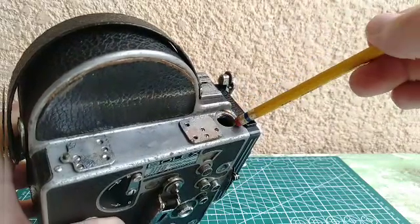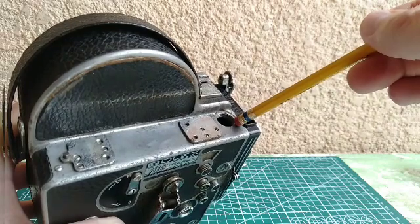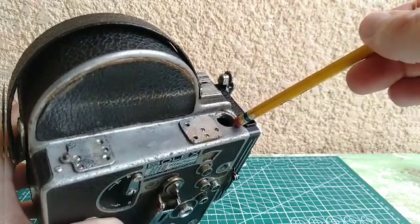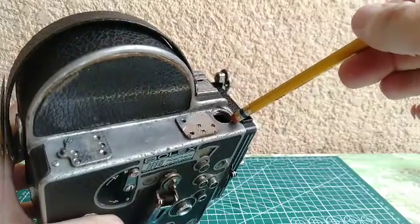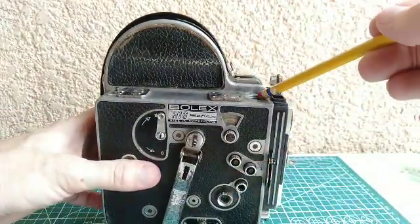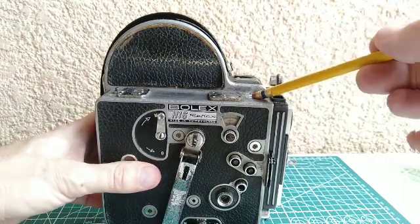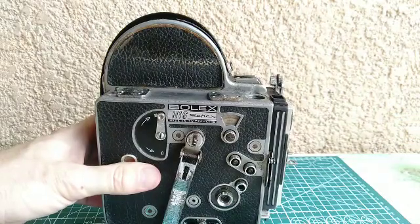Again, this is not a substitute for a professional CLA, which you'll need to have performed every 2 years. If you're working in a dusty, sandy area, a new CLA is required every year and a half. And if you just purchased your Bolex from eBay or another online market or the like, never believe the seller's weasel clause. The minute you get your Bolex in, send it off for a CLA. Otherwise, it's going to lock up with all the old lubricants that are solidified.